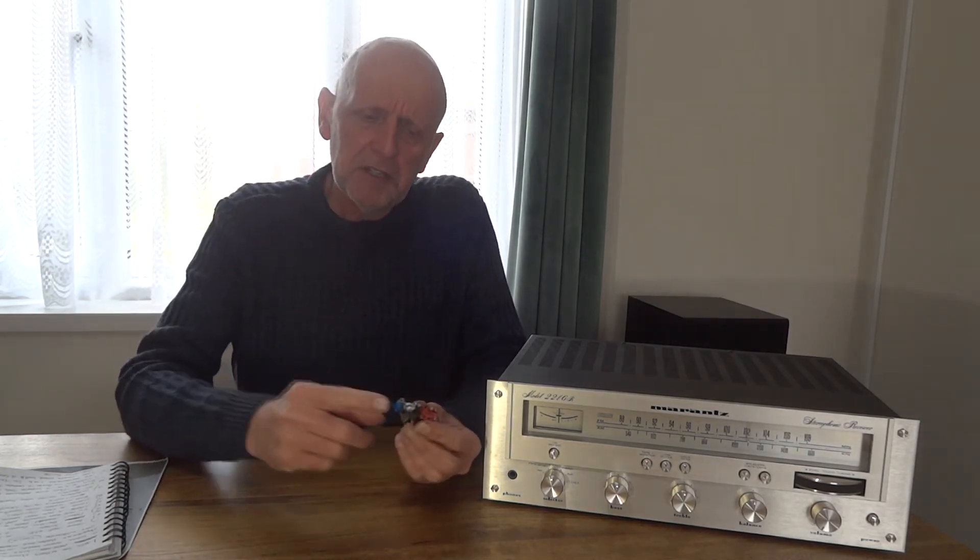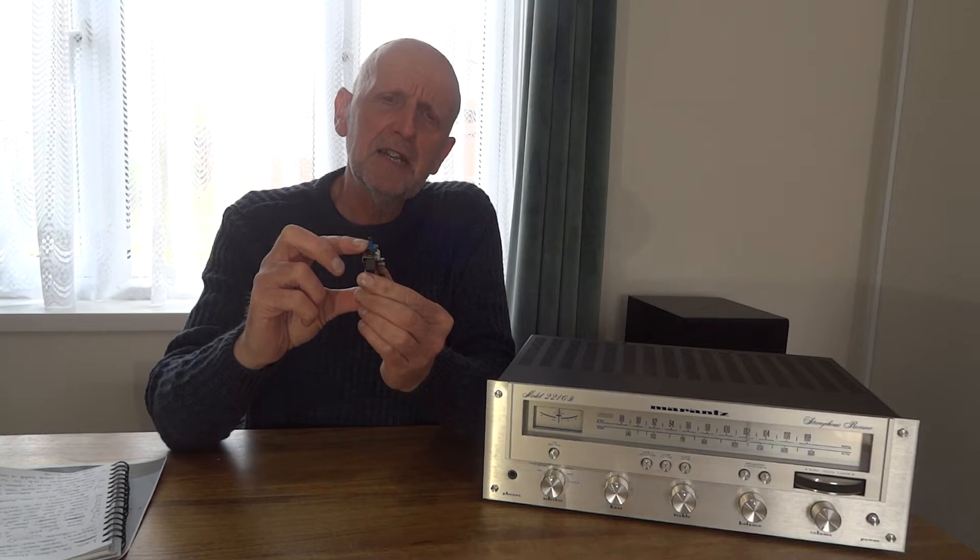It can give interference — a kind of noise coming through. You'd probably notice it most on the radio, hearing some interference, bad reception. I tried to capture it on video many times, and of course it worked perfectly when filming. I've got a couple of little videos where it happened a few times. I've kind of helped it along — as I pushed the switch in I wiggled it up and down a little bit just to give you an idea of where the contacts aren't quite meeting up properly.